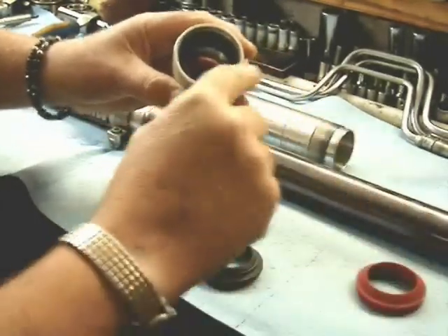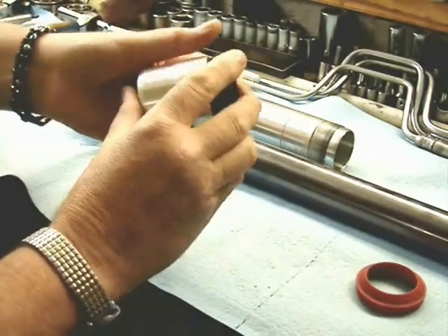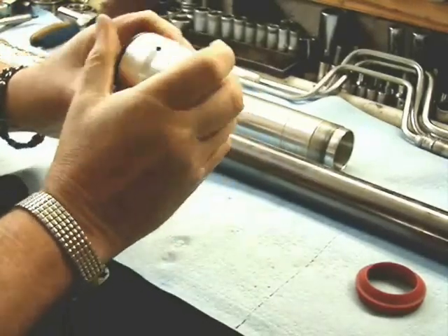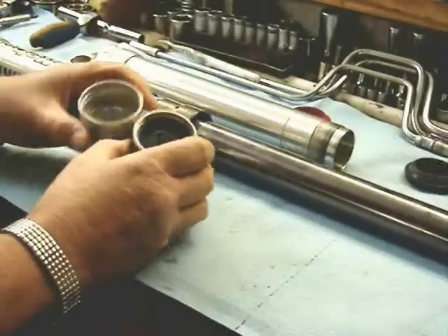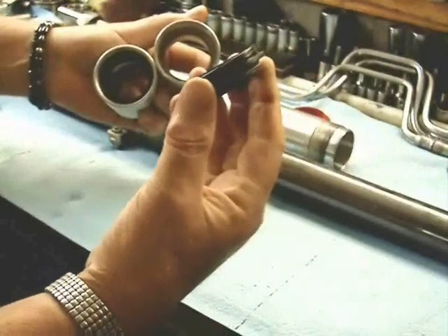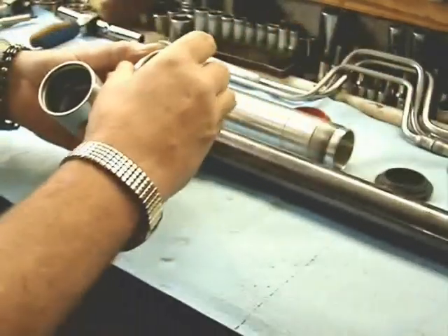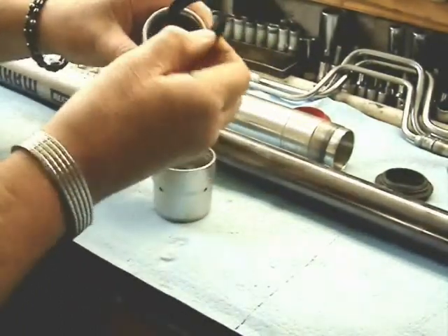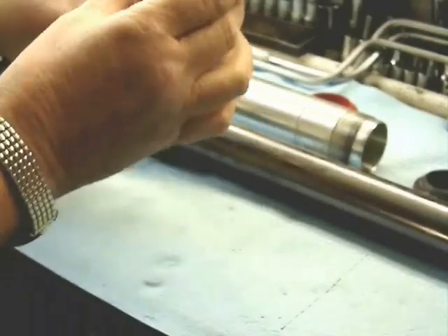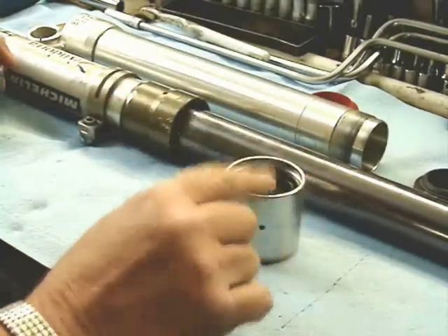In 1995 there was a change due to unavailability of seals — they changed the outside diameter of the fork seal to 50 millimeters. Most of them you'll see are 38-48. There was a brief period in 1995 where they were 50, so there is a variation there, and the wiper will also have a 50-millimeter exterior diameter. If you're unsure about the diameter of the cap, you'll need to take one off and put a caliper in there, because the 48-millimeter wiper just falls out of the 50-millimeter cap. So if you have a '95 bike, you have to determine if you have the 48 OD seals or the 50 — they're not marked, and externally the caps look exactly the same.